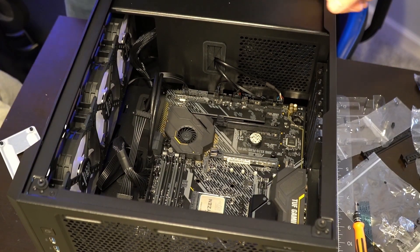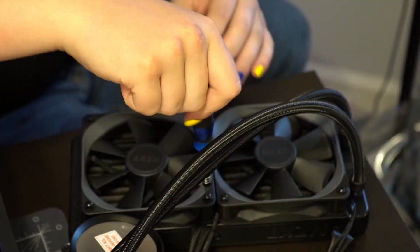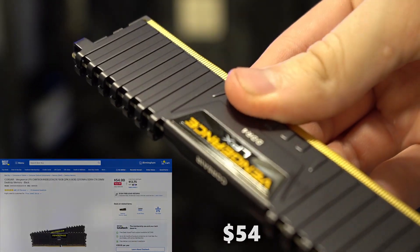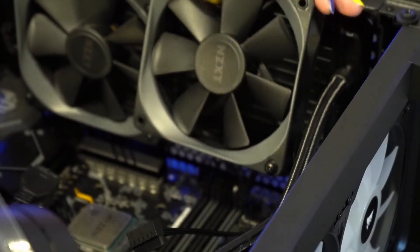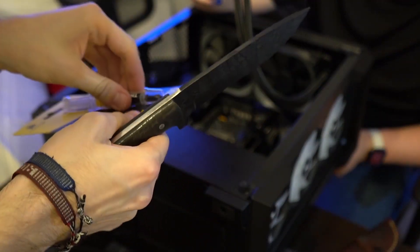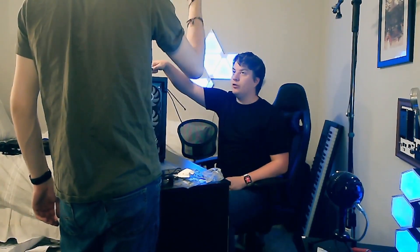So first let's put the fans onto the rad. Alright, now take off the thermal paste cover and put this bracket on before we put this on. That's the only side that clicked for me. Put the fan back on. Knife time — I really don't want to hit the thermal pipe. Just tiny dots on the corners to get full spread. We can pull the wires back through the same hole.